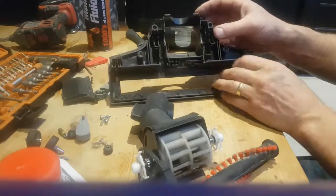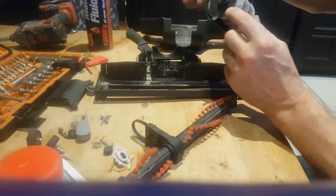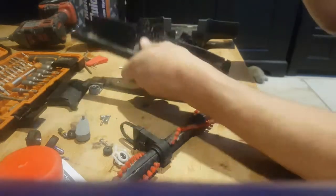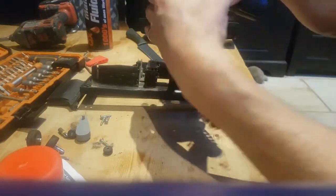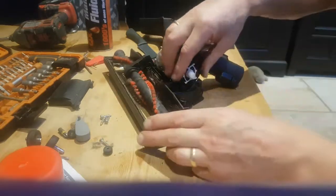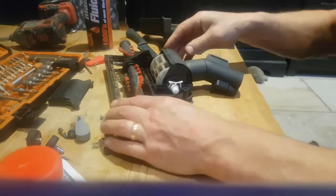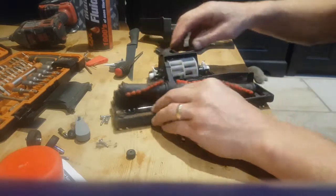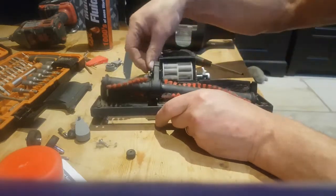Also worthy of note - two guides here. These sides go inside those two guides, so that sits in there. Just put the drive belt back on. Rest the brush in, and make sure you've got it in the guides. The V's should be pointing down, and you're not locked in because the two white pieces are sticking out - so when it's fully home they'll be sticking in correctly. That piece is done.